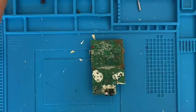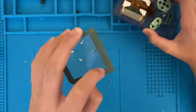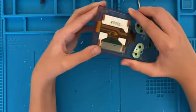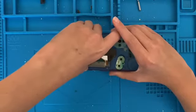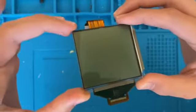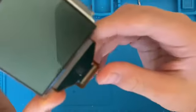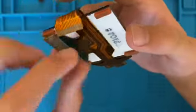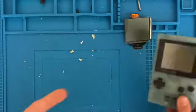The only thing that is left is the screen. The screen lens has just come off — it's got all stuff stuck on it. So if we just carefully take this screen out and lift it out, the front of the screen looks in mint condition — hasn't even got a smudge on it. There is some sort of liquid-looking mark on it but there's not actually liquid there. The back of the screen is stuck down with tape, and that looks okay. I'm going to disassemble this and swap the screens over and show you when I test it.